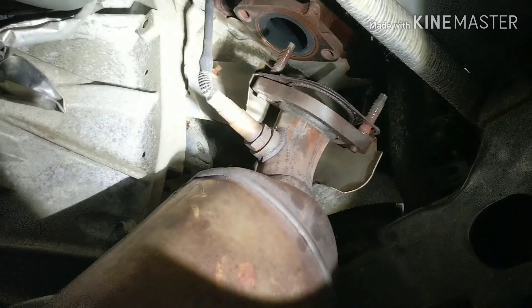What you need to do is unplug the O2 sensor — that plug right there, it's gonna be right behind the block. Feel your hand back there and you're gonna feel the plug. I already unplugged that. There's gonna be this heat shield. I got a swivel and a 10mm with a little extension and a drill. Remove this from the top — that one and this one from the top — then come on the bottom under the car and remove that one. It'll come right out with the impact drill.